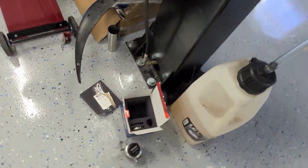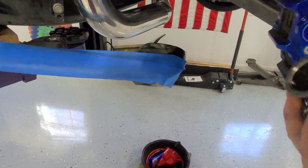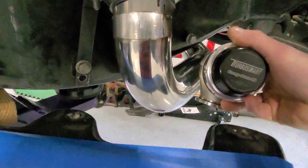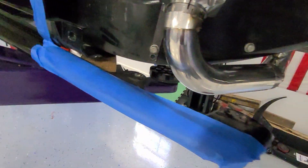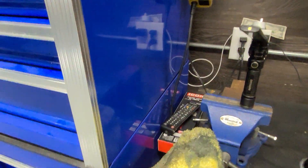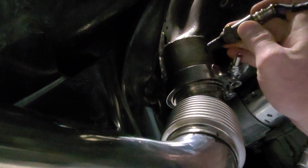When the X-pipe shows up, we can do that. We're waiting on some more stainless as well. In the meantime, my Turbosmart 40mm wastegate showed up. I think I'm going to mount this right about here-ish, and the dump will just go straight down. So figuring out how we're going to mount these wastegates and where we're going to want them to dump is the next part of this hot side. We also need to drill the hole in the passenger side manifold for the O2 sensor. A little more fab work to do on a couple of these things, but up pipes are basically done. Do the down pipes, and then we can call the hot side done.